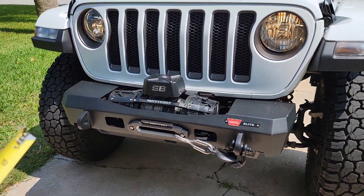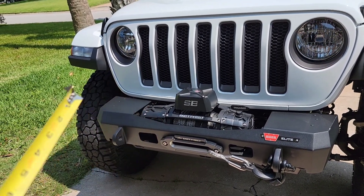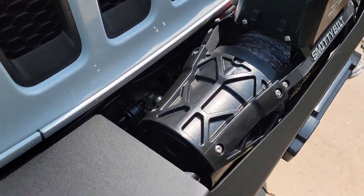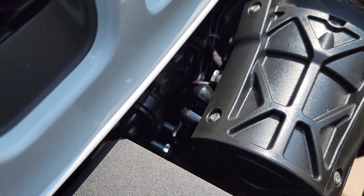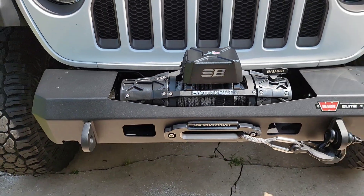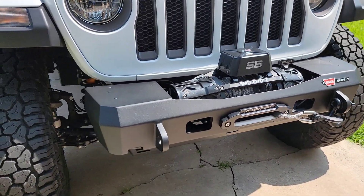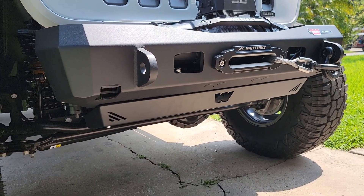Bumper is completely on and winch is installed and wired up. Note to everybody: put the winch together and wire it to itself before you put it in the vehicle — I thought it'd be easier to do it with the bumper empty, but it was not. You can see the clearance to get to the wires with big hands is not the greatest — it was doable but tight. That's a Smittybilt 9.5 Gen3 XRC that I got in a promotion a few years ago — it's just been sitting, now finally getting used.